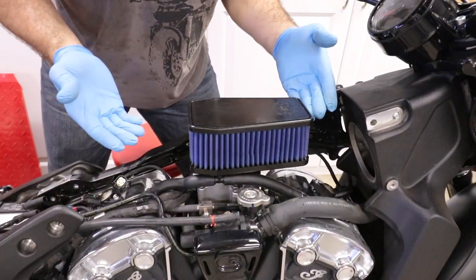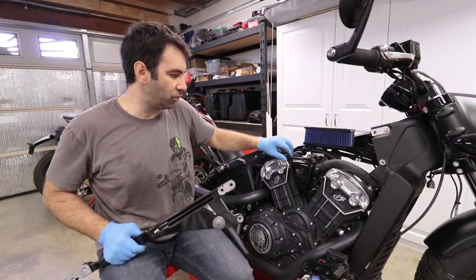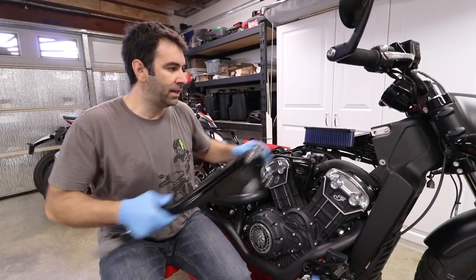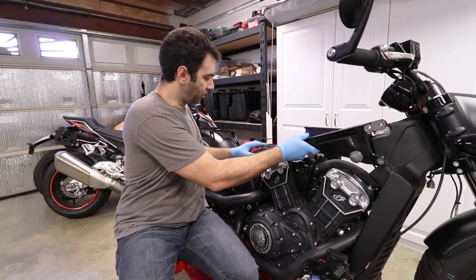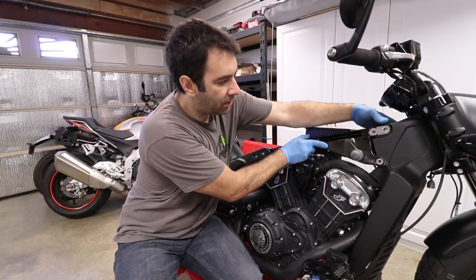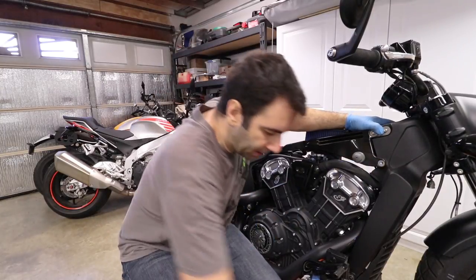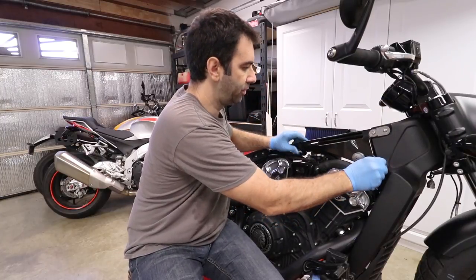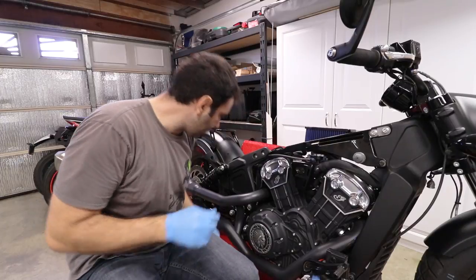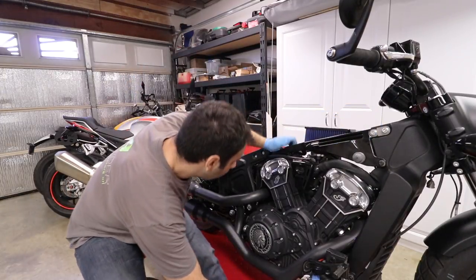That's it, air filter is in. At this point it's time to put the backbone back on the bike. The filter is all tight and everything is connected as it's supposed to be. I'm gonna leave this untied for now because I need space to put the fuel line back in. The back side goes behind and the front side goes up front. Push those two bolts through like that — the instructions call to install the little one first. Once all the bolts are in the proper position, make sure that nothing is pinching and nothing is in the way.